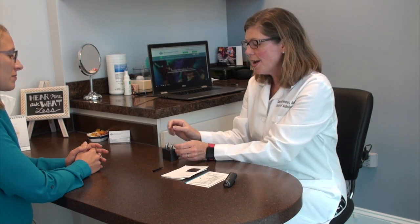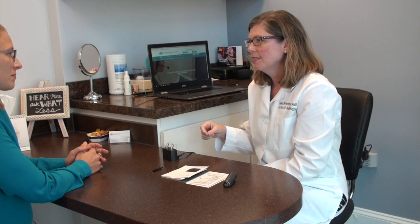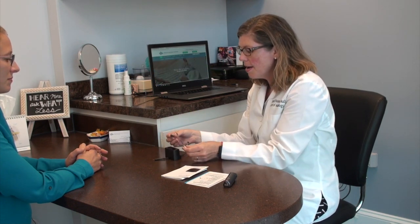You do not have to open the battery door — keep the battery door closed. If you're ever going to unplug the charger, don't unplug it while the hearing aids are in it, because you can actually reduce your battery life that way. For example, if you're going on a trip, first take the hearing aids out of the charger, and then unplug the charger, wrap it up, and go. Don't unplug it first and then take them out. Also, if you've unplugged the charger and you want to put your hearing aids in it, don't put them in an unplugged charger — again, you can reduce your battery life.